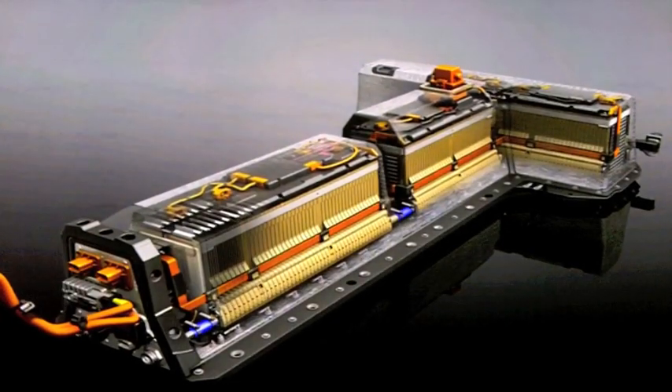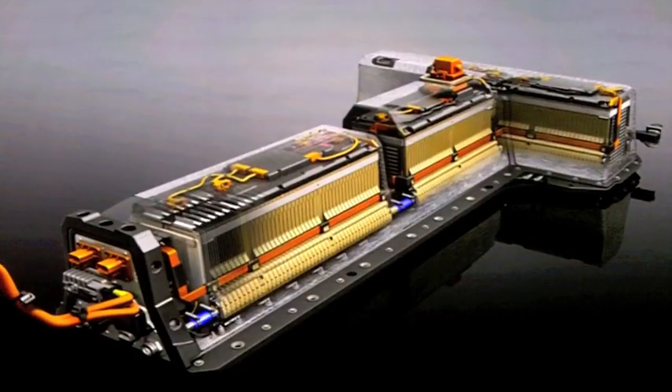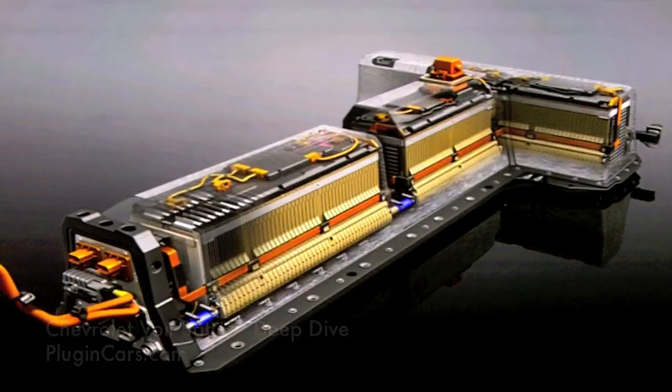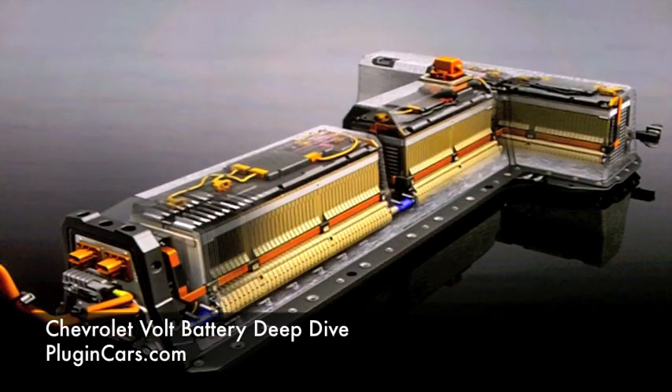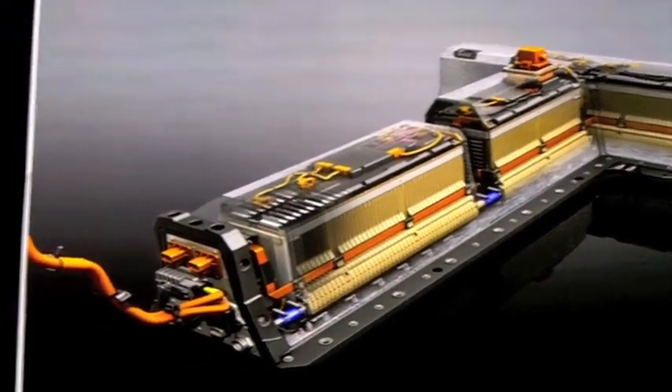This is the battery system in a reveal look. Some of you may have had the opportunity to be down at the battery lab, which is actually right next door to this building, or we've got two events down at the battery assembly plant. The last one in July, we actually showed the inside of the battery. Lithium ion technology — the cell is supplied by LG Chem out of Korea. It's referred to as a lithium ion polymer cell, polymer referring to the packaging. That's a soft pouch cell, not a hard can. It's basically a mylar aluminum foil.